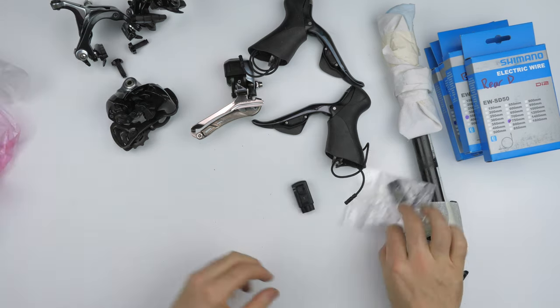Okay, next thing, climbing shifter. We have a spare port over here. We can plug the climbing shifter in and see how everything goes. Probably wise to disconnect the battery before plugging anything new in. So into the second port on here, which I believe isn't the sprint shifter port, which duplicates the buttons. We will soon find out.